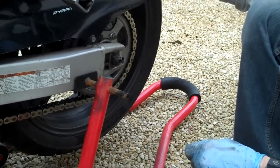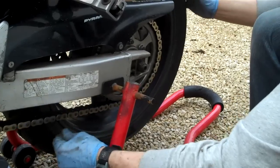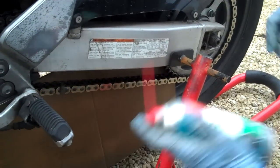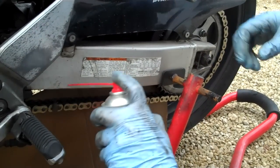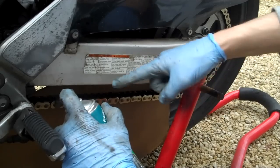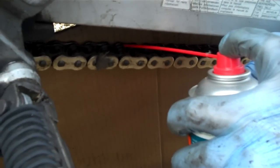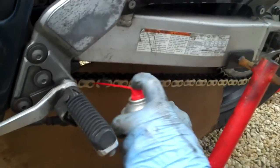I can't stress how important it is to get your rear wheel alignment perfect every single time. Once the chain has been adjusted and is correct, now it's time to lubricate it. I see people spraying on the outside of chains — utterly pointless. You've cleaned the chain, got all the old cack off, opened up the metal to air. Use the foot peg to steady your hand, hold it still, and point the nozzle at the inside edge — right up against the rollers — so you're running the lubricant down in that gap where it needs to be.